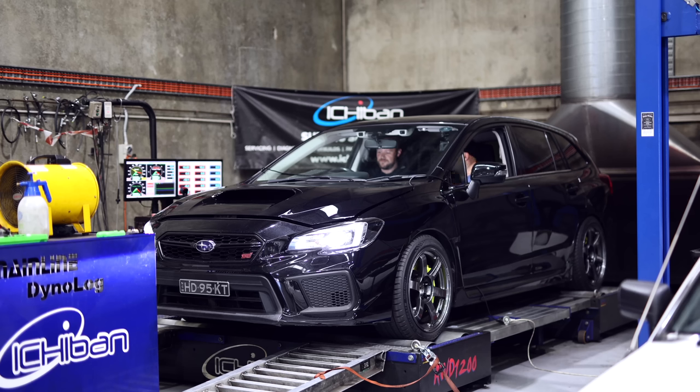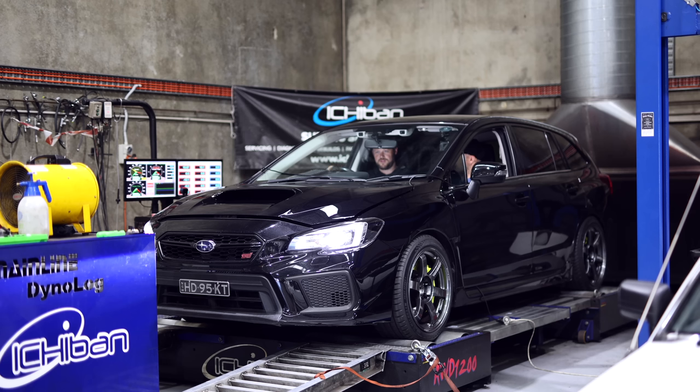If it's spinning up that quickly, it's breathing. Generally, you'll make 5 to 7 kilowatts per pound of boost. So, you know, 4 fives is 20, so it just rolls over. So when people get greedy in EJs, is it because they run out of boost and go, well, I'm going to find power somewhere else and start creeping the timing up? Yes. Cylinder pressure is the biggest thing with EJs, holding their heads down. They'll make really good power with lots of timing. Just because you can doesn't mean you should.